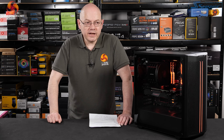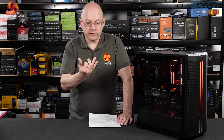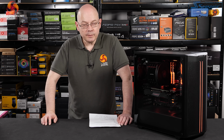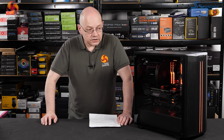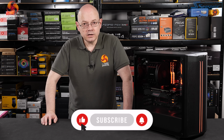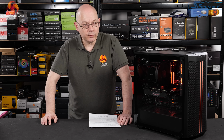While we're on that subject, I've now got a fan on the CPU cooler and 3 fans on the case fans, that's 4 in total. This motherboard supports 4 fans without any difficulty whatsoever, but you're in the territory where a small fan hub would be a good idea. But the ideal thing would be PWM fans and a PWM hub. So that is one area I'd definitely like to see a little tweak done, please Be Quiet. Perhaps call it the Purebase 501 DX, because we are talking just a small upgrade.